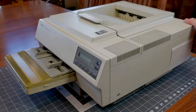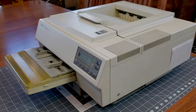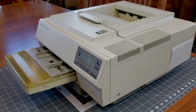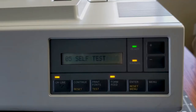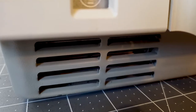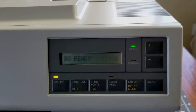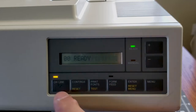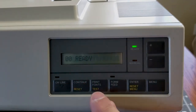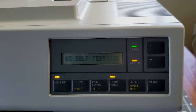Let's turn it on and see what happens. After turning it on it goes ahead and runs through an automatic self-test and this seems to be going just fine. However that fan does not sound good at all — that's the squirrel cage fan for the bottom of the case. Once the printer warms up you run a self-test by taking it offline then hold the test button for five seconds until '05 self-test' appears in the display.